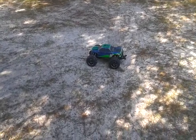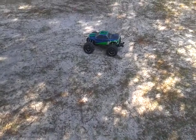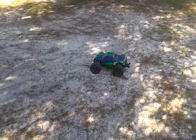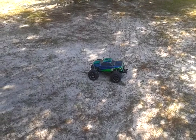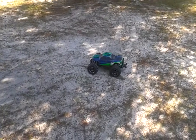I just put two 2S LiPos in it, and I'm running a 2400KV G-Force motor I bought off ValueHobby.com. It's an 8th scale setup, and I have a 150-amp Hobbywing ESC 5th scale on this thing. Let's see what it does on 4S.